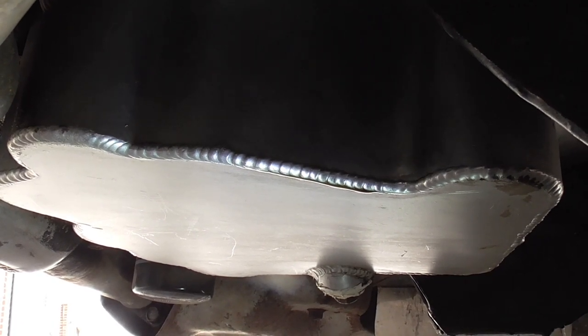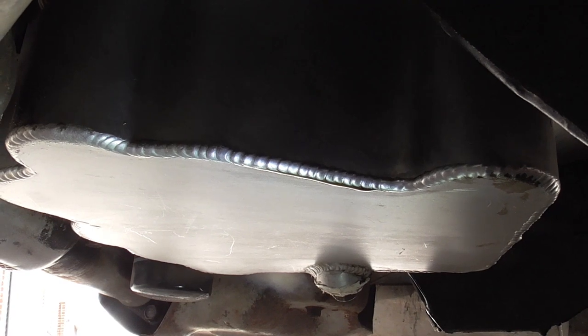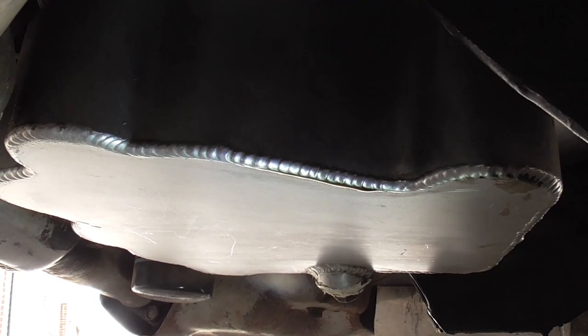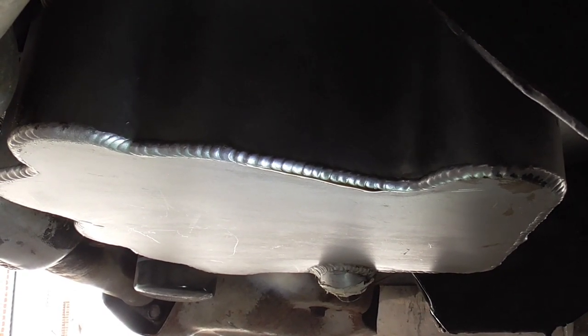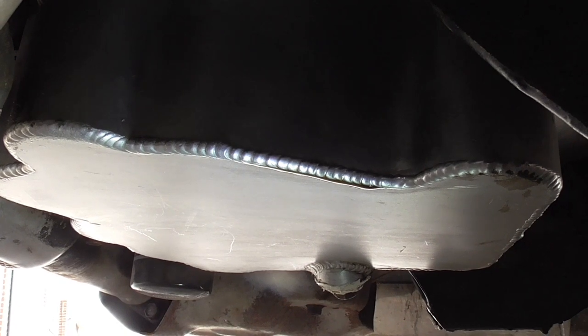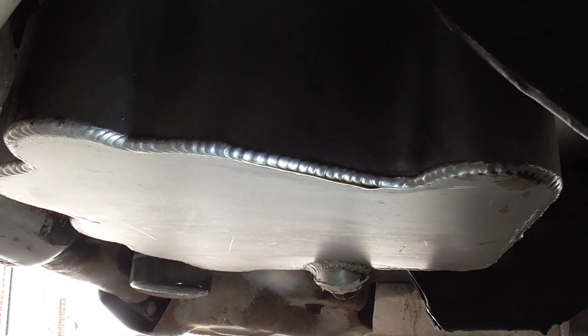I did jump out of gear in, I think it was the third or fourth race. And I noticed before I went down to the pod that the front gearbox mount felt a little bit loose — only a slight amount, a little bit of a judder to it when you were setting off the lights. So I went underneath and tightened up the front gearbox mount just to make sure it wasn't moving anymore.